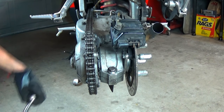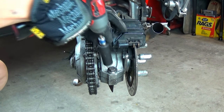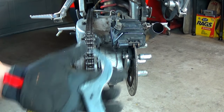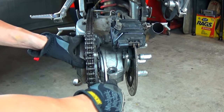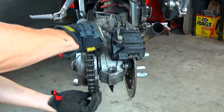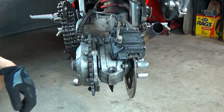I have to remove the axle nut from the driven sprocket, and also remove the chain adjustment lock bolt. Here you'll need Honda's chain adjustment tool that should be in the little tool pouch that comes with the bike. If you don't have one, visit my Etsy page and I can custom create one just for you. Do try to keep the chain from touching the ground.